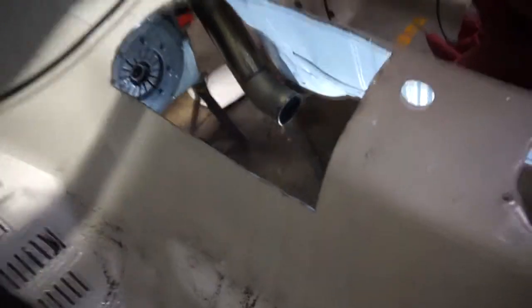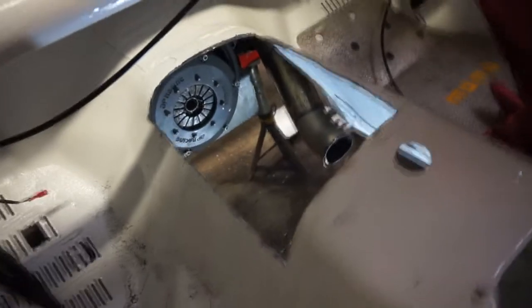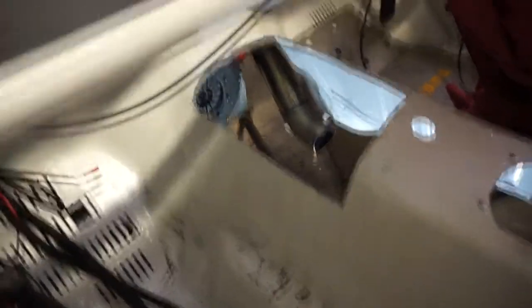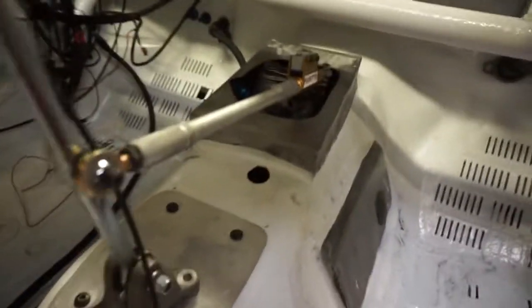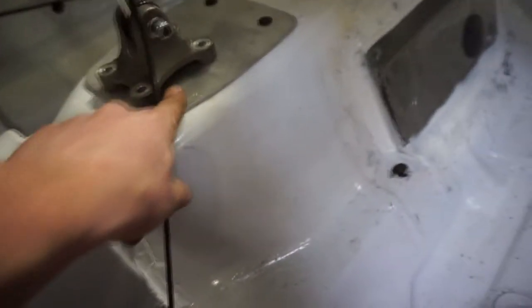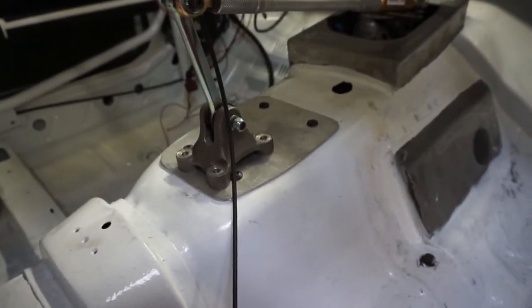As it turns out the box is a monster so we've had to make a wee adjustment to the tunnel, so hopefully it will fit in this time. That's the box and we've had to plate up two bits from the tunnel just because of the size of the box. We've got a big grommet to go on the top there and then obviously you've just got your shifter back here. It's actually torqued bolts holding them down - that's just so if we ever want to go back to an H pattern we can, just to fit in with certain regs.